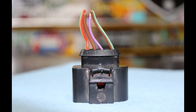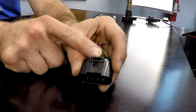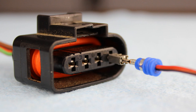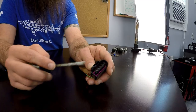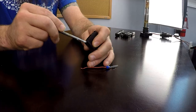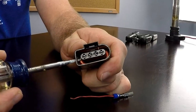Let's talk about what makes up an ignition coil connector — this applies to most Audi and Volkswagen connectors, whether it's an ignition coil or anything else. First, you have the body of the connector, which on one or both sides shows how many pins are in it. You have the lock, which clips inside to lock it into the component. You have the pins, which are the wires. You have two different seals: an orange seal on the inside, and seals where the wires enter. You have a secondary lock, which is the purple piece on the inside, and a primary lock located on the wire pin itself. Here is the secondary lock — you can see the purple piece there, as well as the orange seal inside of the connector housing.